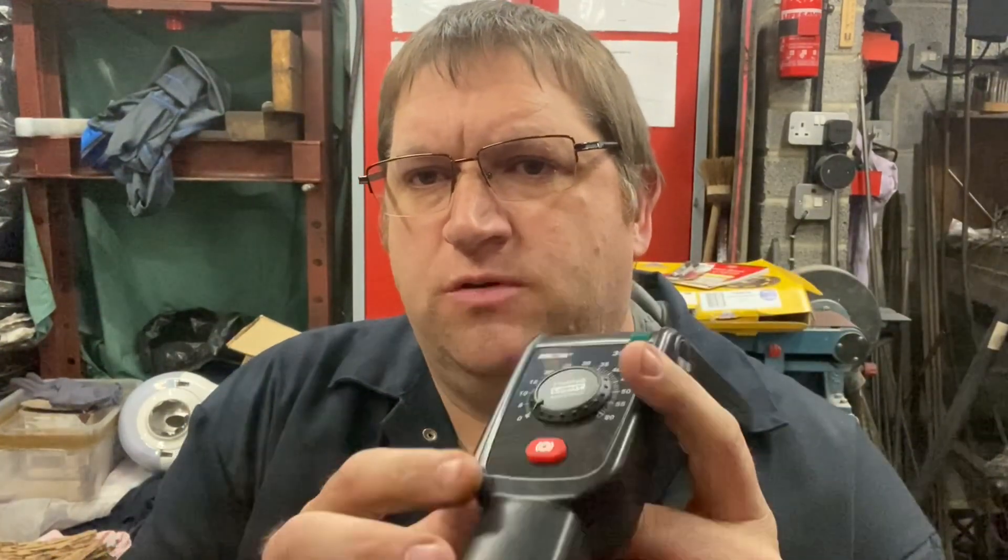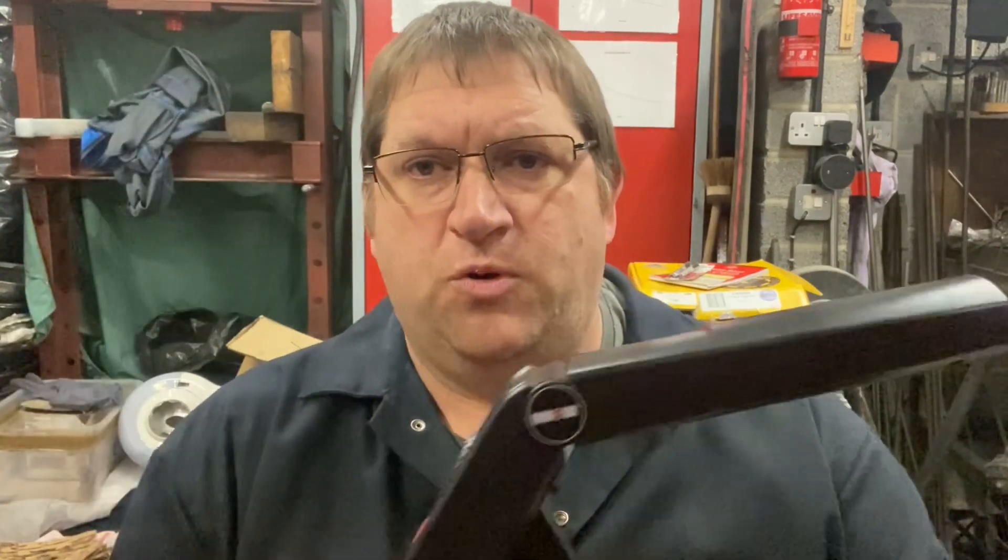Back in the office with the 3555 — one thing I did like about it was the one-handed operation. I could quite easily move the dial around to get the timing setting I wanted, which was great. But what let it down is that on two engines I tried — which we didn't film — I couldn't get a reading at high speed. The engine we did film was the one I could get a reading on, but it wasn't the best. So I was a bit disappointed, because I was expecting good results based on the 5568. It's starting to look like you need to spend over £100 to get a timing light capable of doing performance timing to set up a classic engine with a distributor. Anyway, I hope you found that useful. Thank you very much.